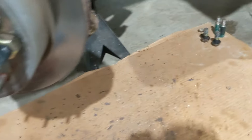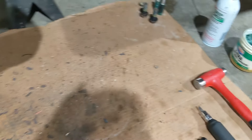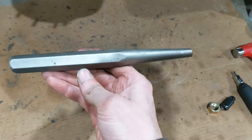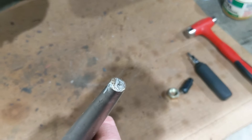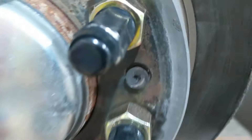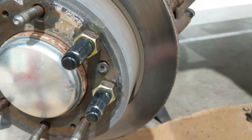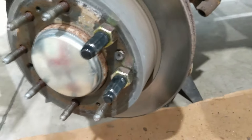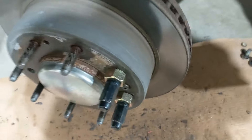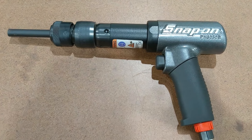Then I was beating on it by hand with a 16-ounce Snap-on dead blow and a chisel — part number PS1232, which has about a 3/8-inch tip. That worked pretty well for beating on the head of that screw. I cranked those lug nuts down, beat on it, and it was starting to come but still not quite there. What I ended up using was an air hammer. I think if you beat on it long enough by hand you'd eventually get it, but I went to the air hammer.